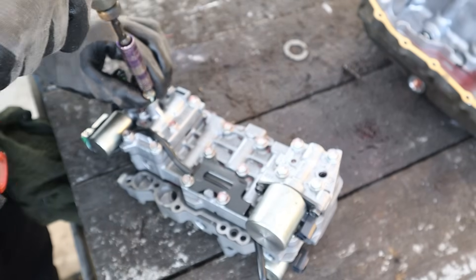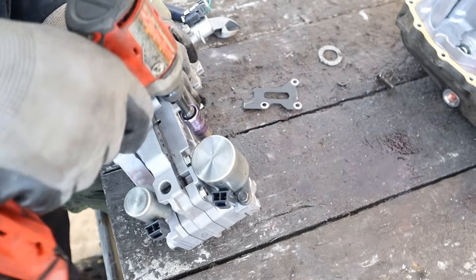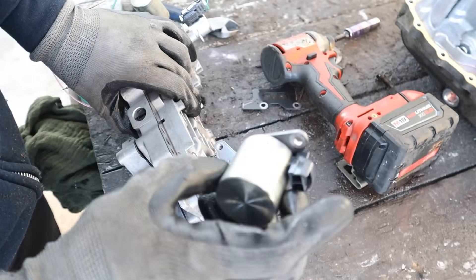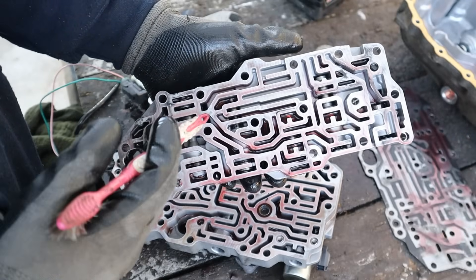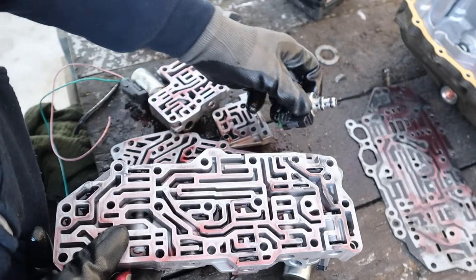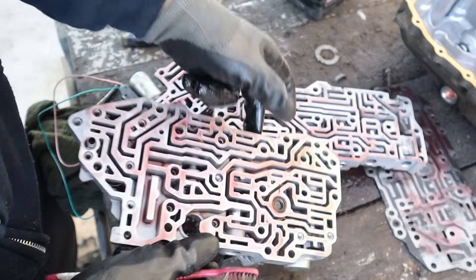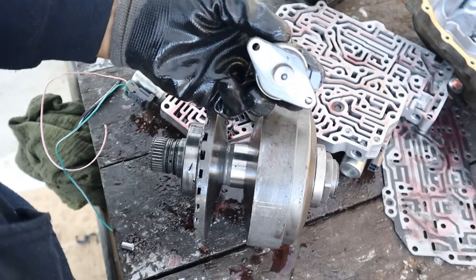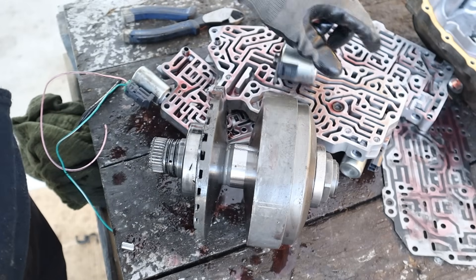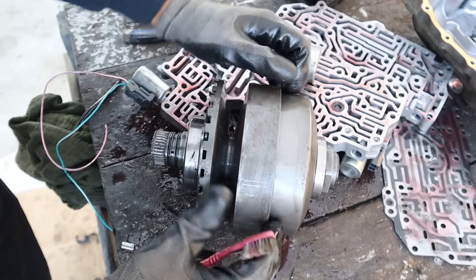Speaking of the valve body, I'm going to take off all the 10mm bolts I can see. On this side you've got an accumulator and a large pusher solenoid with a large coil inside. The valve body on the transmission is basically the brains — as you can see it's like a maze in here, and it's going to use fluid pressure redirected by these solenoids to fill different cavities and functions inside the transmission. There are also special screens that could get clogged that you've got to watch out for, but this one's in pretty good shape. For example, this solenoid would kick on a spool valve inside of here, and that would send fluid pressure to this shaft to expand or contract the variator.